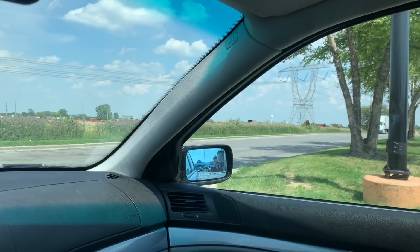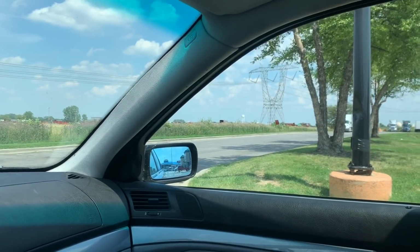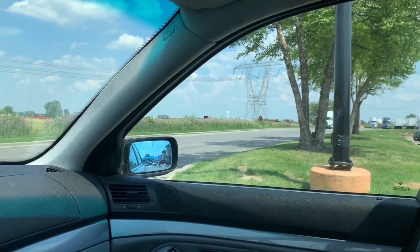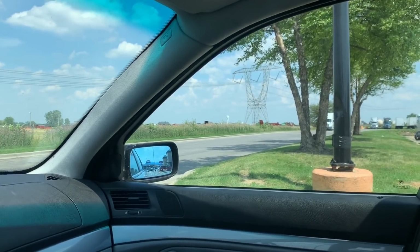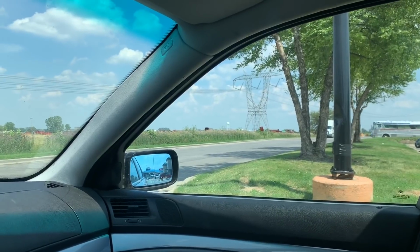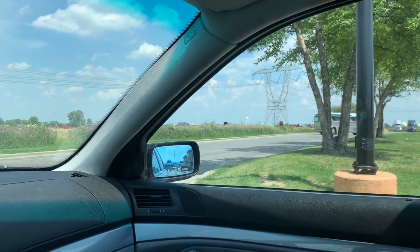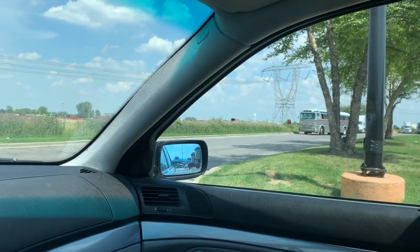At a truck stop, I went ahead and fueled up and we shot all the temperatures on his, and right above the thermostats was 183 on both. Engine oil level was a little bit above full, but it was at a weird angle when I filled it this morning, so I think it's just got a little bit extra oil in it. So here he comes.